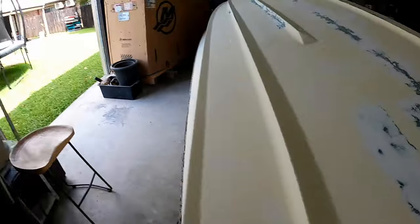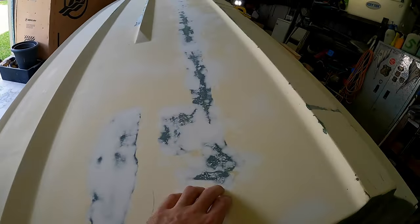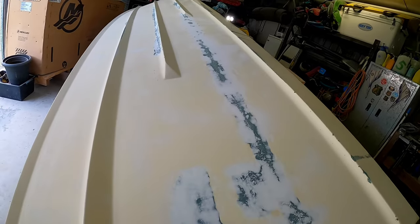You would have saw a shot there of the bottom of the boat with all those stone chips where the pad was sitting when the boat was upright — I hadn't actually attacked that point yet. Pretty well the whole back end of the boat looked like that, little tiny stone chips all across. How I tackled that was a pretty runny mix of fairing compound, basically smeared across just about the whole bottom of the boat and then sanded the whole bottom back. Huge effort, but I think it was definitely worth it — I ended up with a really good gel coat result.